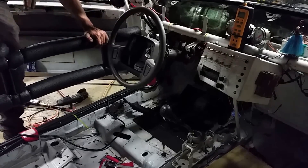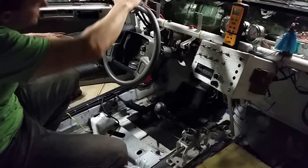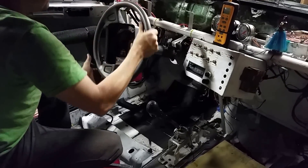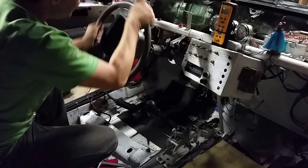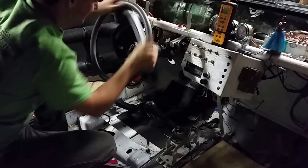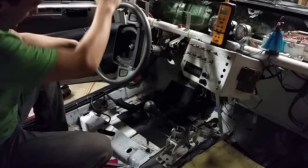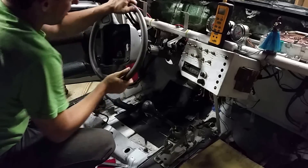Okay, Team Pentastar. This is the manual steering efforts in our 92 Plymouth Sundance. Go ahead Cory. That's quite a bit. This is the two-turn lock-to-lock rack, so it's actually about two and a quarter turns. That's without the engine in, so there would be more weight on it — then it'd be harder.